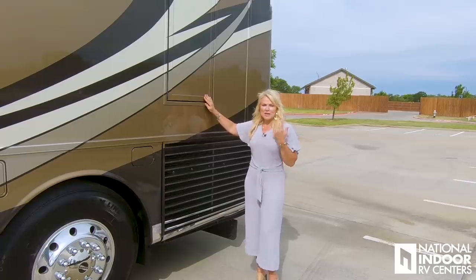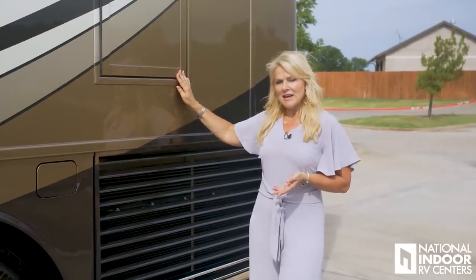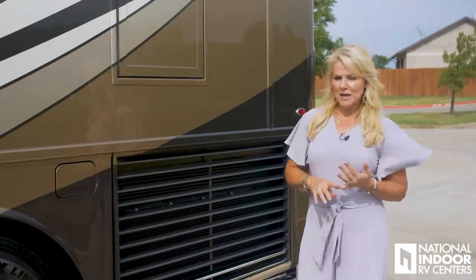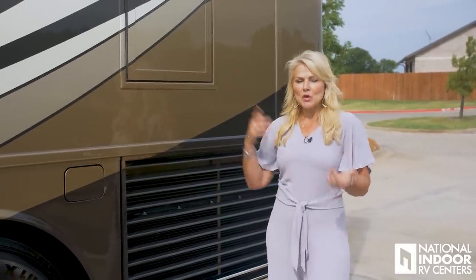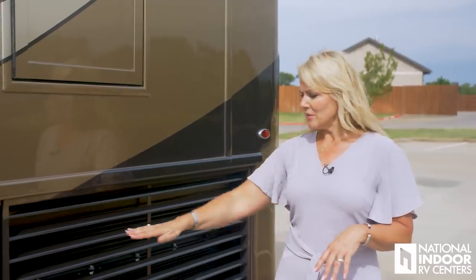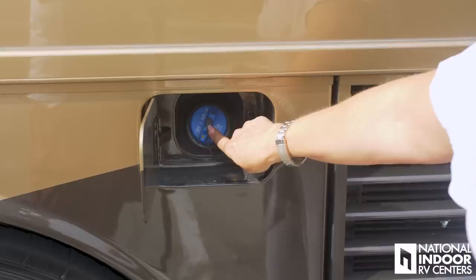We also have the emergency egress door — another safety feature and attention to detail from Newmar. It gives you another way to exit the coach in an emergency. It opens only from the inside so you see no handles, making it as seamless as possible. There's a telescoping ladder that comes down and it's very easy to get out. You can also use it to load and unload your coach — easily hand items up to your spouse without walking the full length. Over time, debris can build up on the radiator fans, so just take a garden hose, put your thumb over it, and gently wash that off to help maintain your radiator. Don't use a power washer — that's too strong. We also have our dual fill for our DEF tank here.